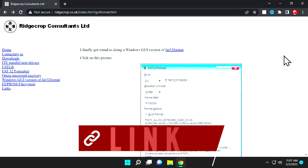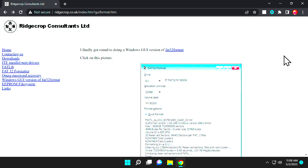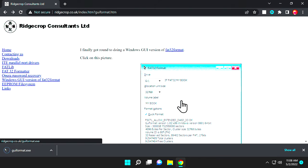About that mass storage device — it needs to be formatted in FAT32 format. If you're going to use mass storage larger than 32 gigabytes, you'll need to use an app like GUI Format. I've got it linked for you in the description. Just click on the big image right in the center of the page and it will download the software for you.